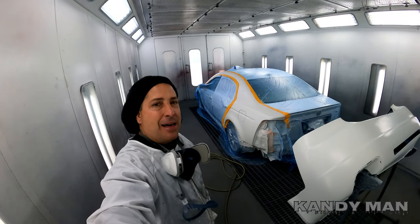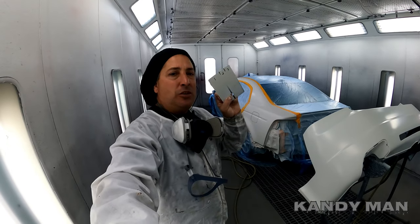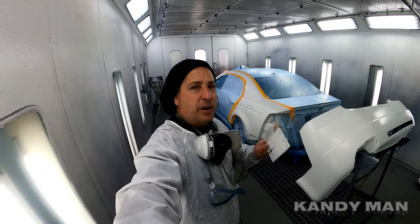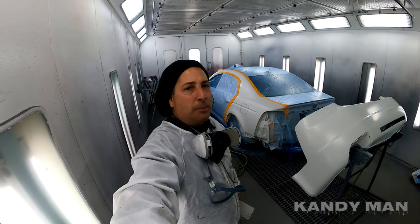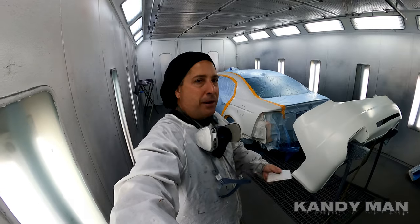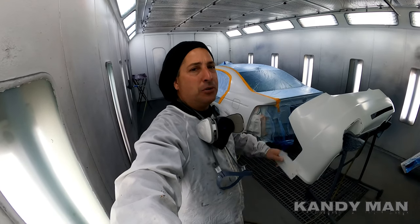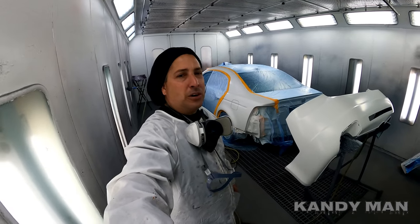All based out now, and we're gonna go to our pearl. So the more documentation you have on your color, the better you're gonna be. So if you got a color that you know is an issue and you got to spray a card, paint something else first, and in the middle of painting that job, go ahead and spray your card, because when you get in the booth, you want to paint. You don't want to be checking colors, you don't want to be tinting colors, you want to be rolling, and you want to get in and out of that booth as fast as you can and with as less problems.